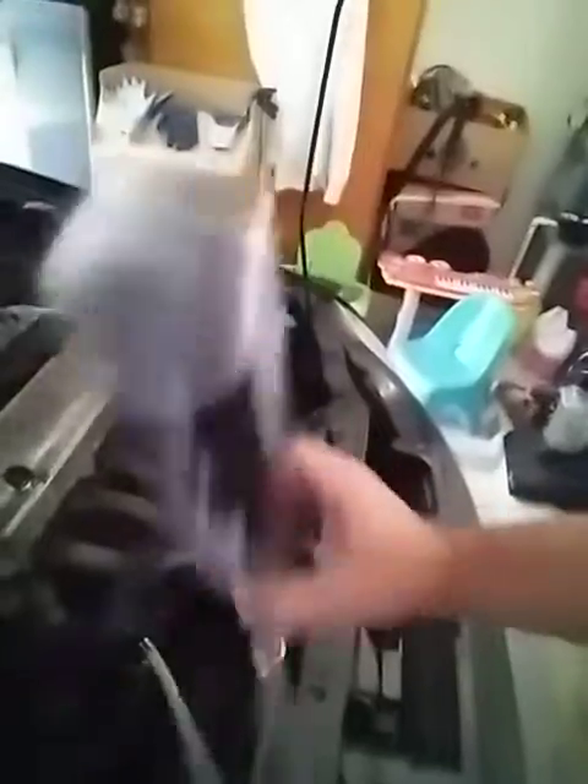That could be because sometimes you have these switches inside your air conditioning system that go on and off — low side, high side. So assuming your switches are all okay, this should go right up to a good amount — a little better than it was before. And there it is — when the air conditioner kicks on it goes up to around 45. I'll do this one more time, back and forth. Pretty simple. Then you read your gauge. If it's in the green zone, I think you're okay.